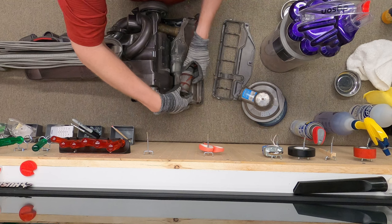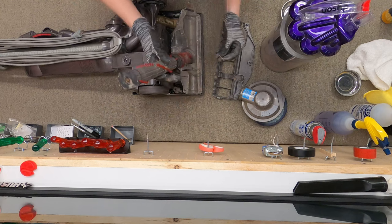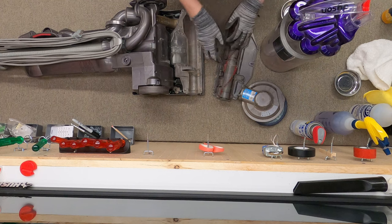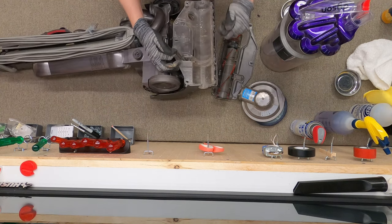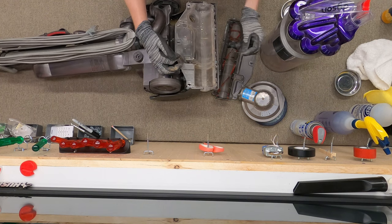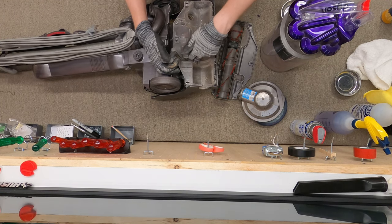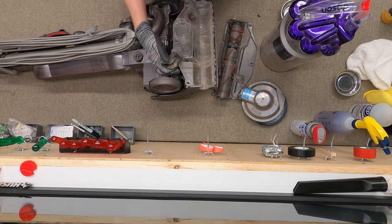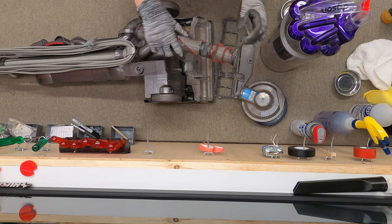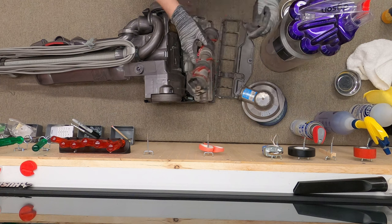Let me get the brush roller out and see what broke off part of the brush roller. This is a newer one — I can tell that by the motor and belt distance. Originally this had a pulley on it, and part of the service procedure now is to take that pulley out because the belt is now shorter and there's a different number of teeth on the brush roller. Yeah, that does not spin — that brush roller is gone.